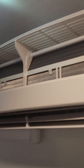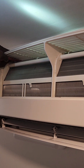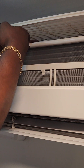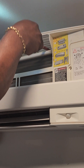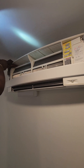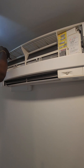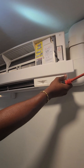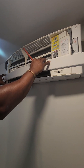The next step after removing those two screws is very tricky. On the top inside, you can do it from the top if you have enough clearance, but in a lot of cases there's not enough clearance. You'll see it has three latches — one in each of the two corners and one in the middle. You have to get a flat-head screwdriver and pop them up, and that releases the latch from the top.